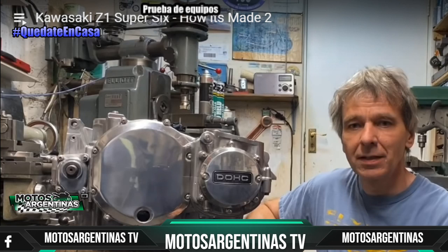The next thing I did was fit 2 new seals for the gear shaft. It's strange on the Kawasaki Z900 because it has a seal on both sides, so it's important to put some grease in between them to keep it lubricated. That's the first one in. Now we turn it over and repeat on this side with another seal, gently tapping in square.